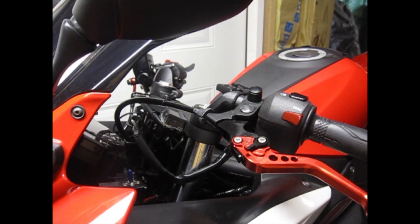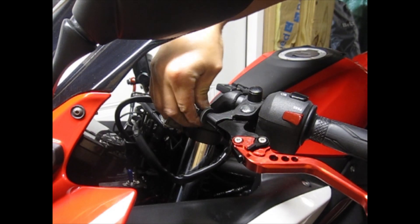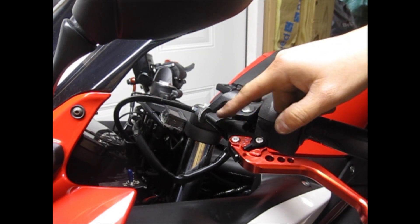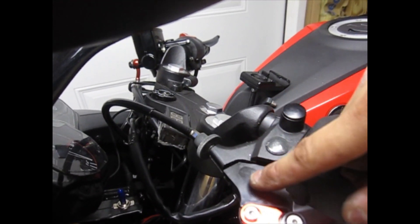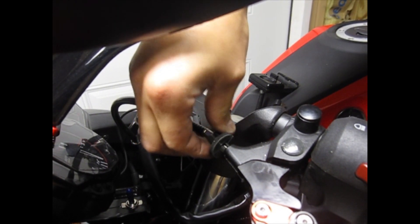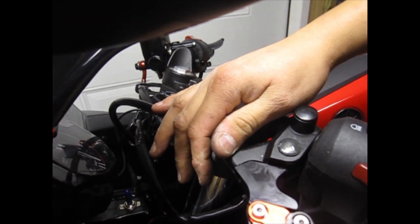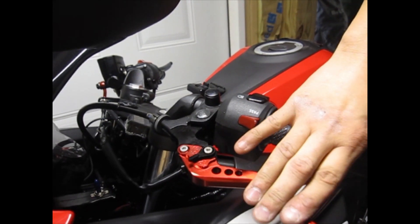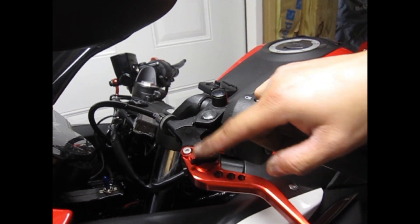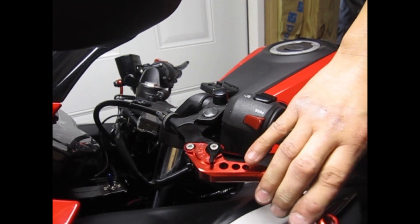Next step is to tighten up the tension of the clutch cable. Put this big circle nut all the way to the end and then start turning it counter-clockwise until you start seeing this gap close up between the lever and this other piece. Keep turning it until you see it close up. Once this piece is closed, just lock it there. At this point, feel the clutch lever to see how it feels. It might be a little tighter than your stock lever — that's why these adjustments are here. I have it set at three; I'll probably put it down to one so it's closer to the grip and won't feel as tight.